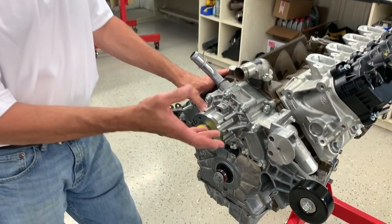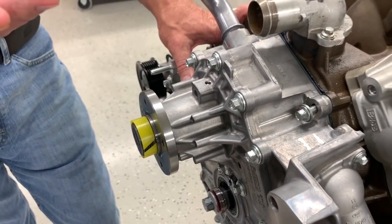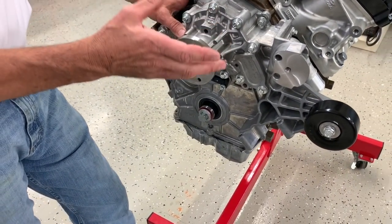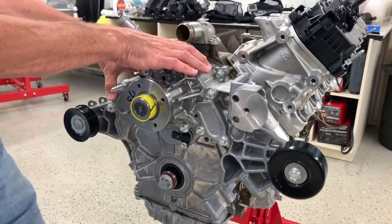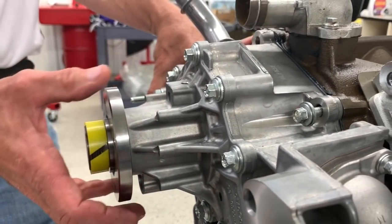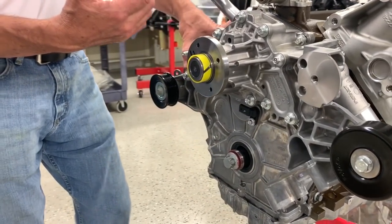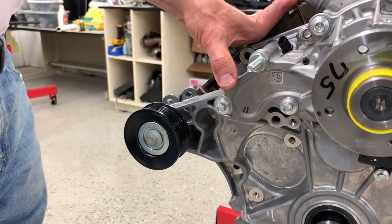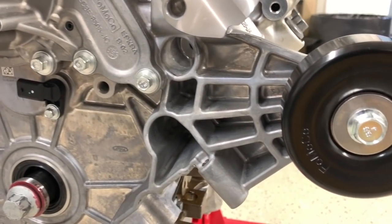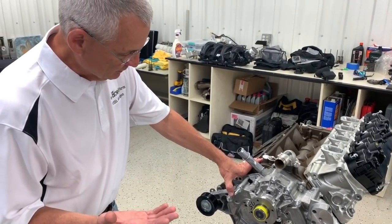We're going to pull the front cover off so you can see the cam drive. This front cover was designed for Super Duty and heavier Ford trucks — really nice and efficient for that. It has a very small serviceable water pump bolted on, but a big chunk of the water pump is also part of the front cover — really just the impeller is in there, with a very large bearing for reliability. Tensioners and idlers are integral to the cover rather than separate bolted-on brackets, making for a nice stiff front cover. Racers will probably look to slim that front cover down.